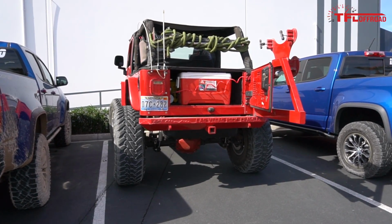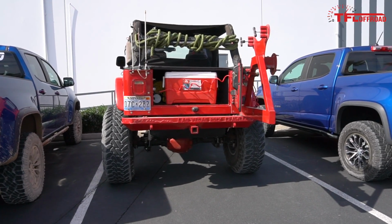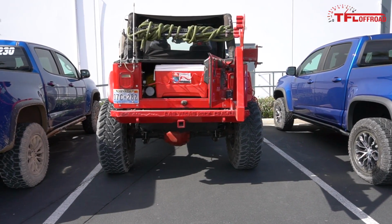They're really strong. There's a ton of them around. Gotcha. The axle width is right. We actually take about 2.5 inches off the bottom of the housing and put a shave kit on it. So a TMR shave kit. We changed the rear suspension to a triangulated 4-link, so it's got 4 bars, and that's really what allows it to flex and keep it centered.